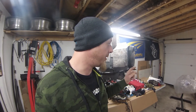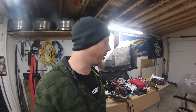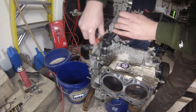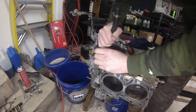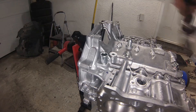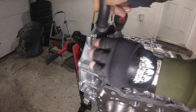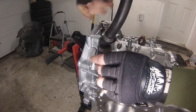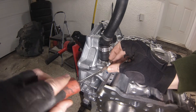It requires the holes for the head studs to be opened up a little bit — just one millimeter, so it's not very much, pretty easy to do. I'd like to get those at least installed and we'll see what happens from there. So first we'll take this off, and it'll just go right back here with the new clamp.